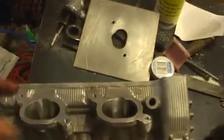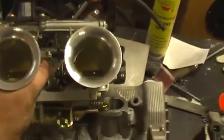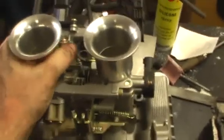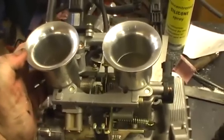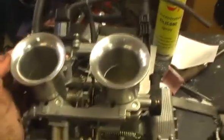What we're doing is these here — I've actually just lightly taken out this here just for where the injectors are going to sit. This is the throttle body unit that I'm going to use. This is a TDM 900. They've been taken out to 41.2 mils — they're 38 mil stock, so that's about 120-something thou for all you yanks out there. They flow a fair bit more now, which is pretty good. I've got the flow bench to take care of that.